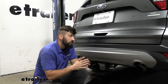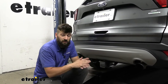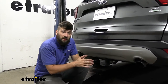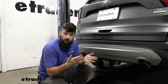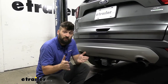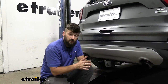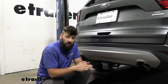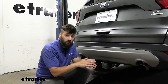This kit is actually going to be completely plug and play, therefore you don't have to do any splicing into the vehicle, which everyone likes. It's obviously nice — we don't want to potentially damage the vehicle or void our warranty. Now this does actually require a power wire to be run to the front of the vehicle to the battery. You do have to run it to the front, but having this powered module light box is really going to help us because it's going to protect everything — protecting the vehicle from the trailer and vice versa. It's also not going to be pulling power from your vehicle's taillight so you don't have to worry about overloading those circuits.